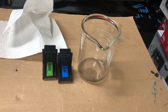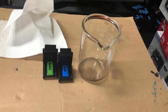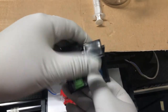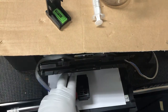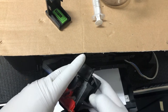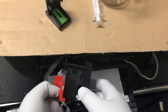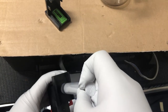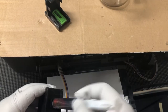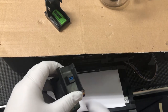So we're going to use the emergency repair tool that's included in the package. Do this over some old newspapers. You're going to have a clip. You can see one of the rubber slots is longer and one is shorter. The longer one is the green one — that's for the black. The shorter slit is for the colored cartridge. Put it on the color one first: center it, press it down and forward. Now flip the cartridge over and use the included syringe to draw ink into the syringe. You can see there are lots of air bubbles — that's what you removed. Then use a paper towel to wipe clean the surface.